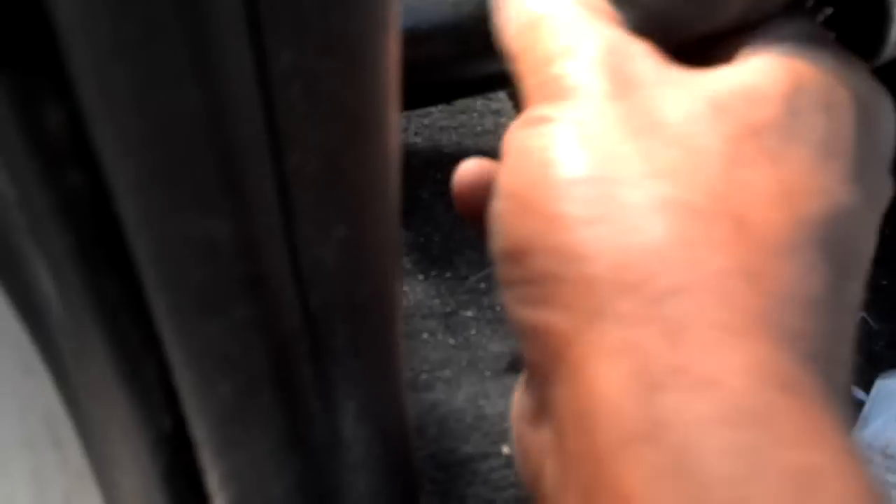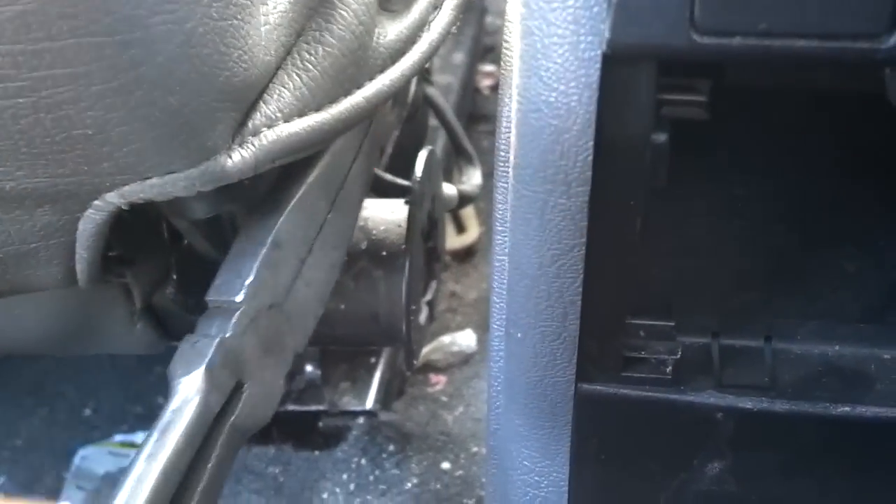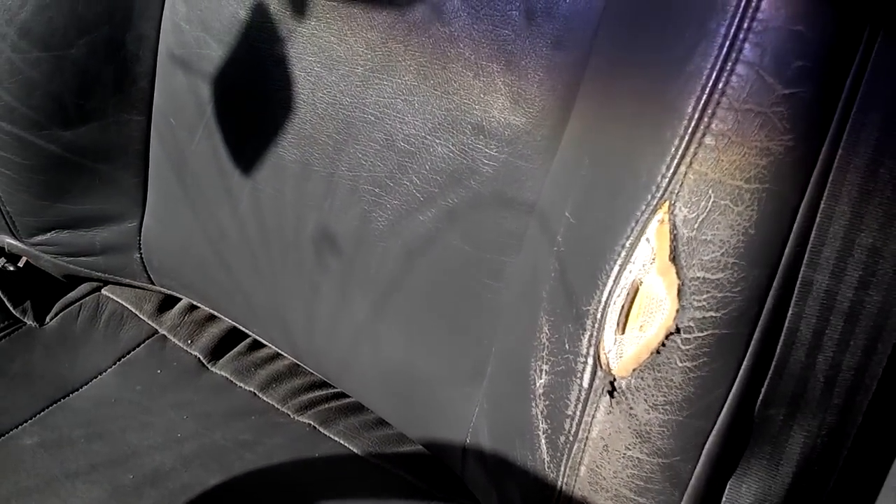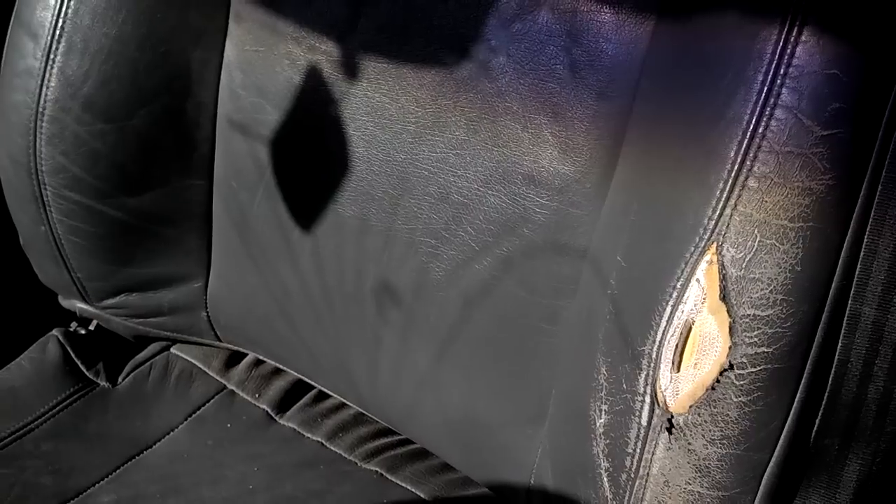Now that the side piece is out of the way, you can pull the vinyl down and off the side of the seat. The easiest way to get the vinyl off the plastic down here was to roll my needle nose pliers in there and twist it to unroll it. Now that the cover is not attached to the bottom of the seat, with the hog rings off the bottom and the sides released, you want to peel the skin of the seat up off of the cushion. There will be a couple of rings on the way that you'll have to take loose as you go up — just start at the front, work your way around, and peel it up.